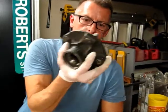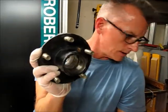So the races are in. We had our share of struggles — we used some old races as tools to get the new ones in, and it was a little bit of a struggle, but we did get them in, no problem. There's one hub, and the other one is around here somewhere. Now we're in the process of packing bearings.